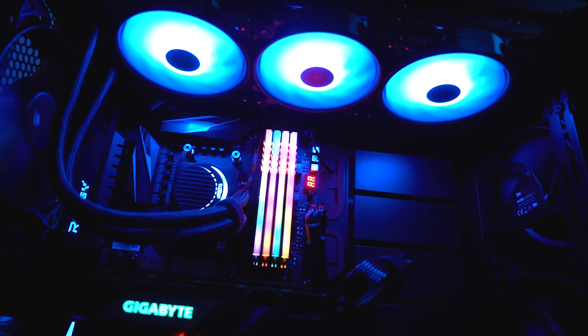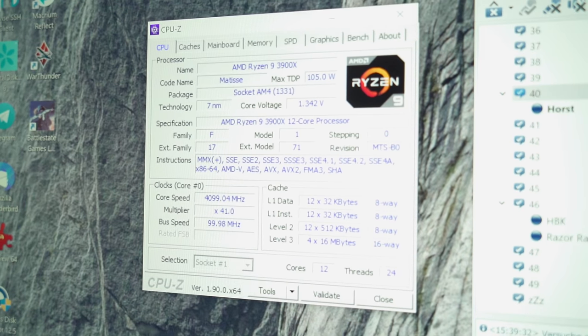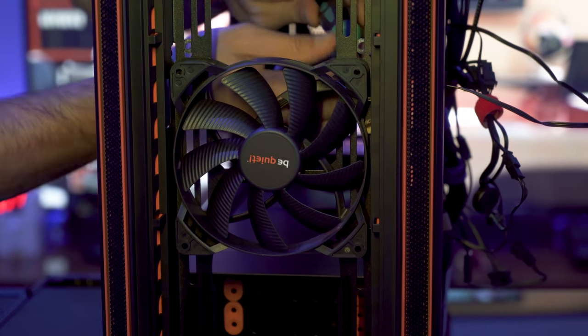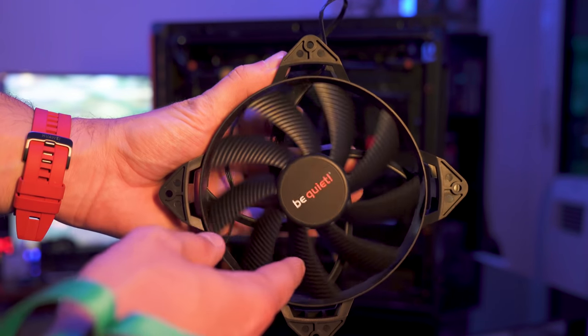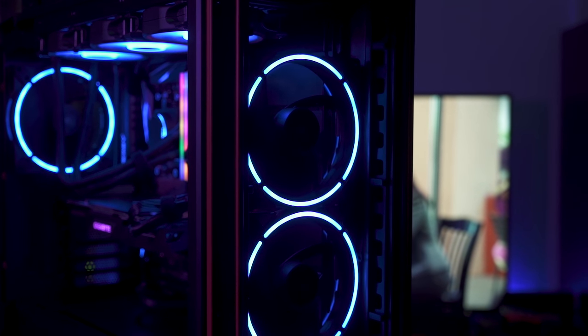To cool the whole system, I'm using a PC Cooler water cooling solution with a 360mm radiator. This water cooler is extremely affordable and produced by PC Cooler in China — they were an OEM company but now push their own brand and make really good coolers. When I overclocked my 3900X to 4.1GHz, temperatures stayed below 40°C under load and around 28°C at idle. I also replaced the Be Quiet 140mm fans with PC Cooler fans — not because of airflow, but because of the looks.